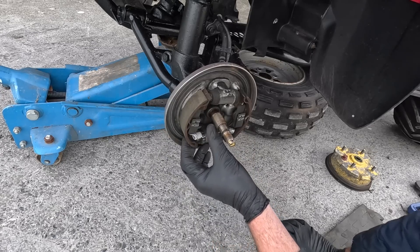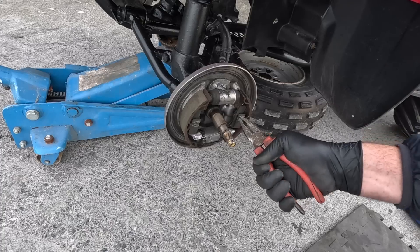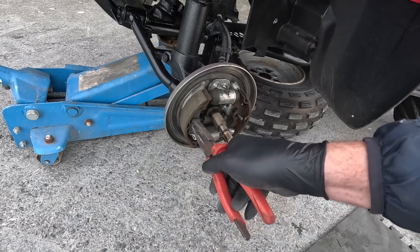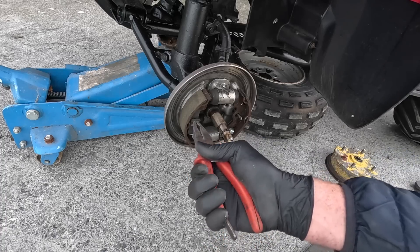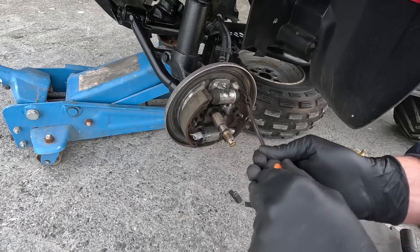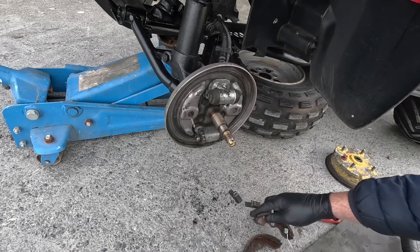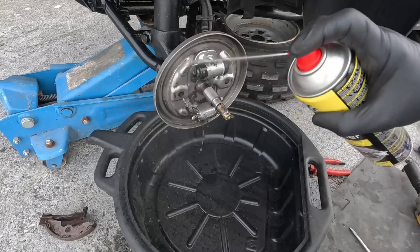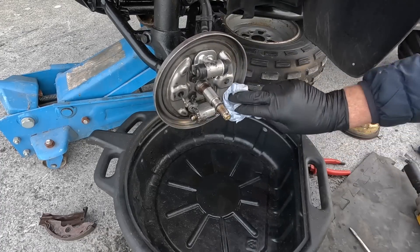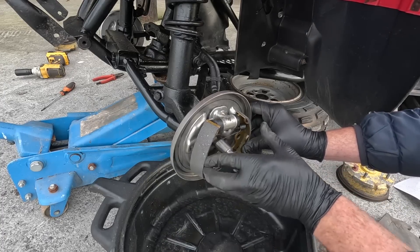They're probably hardened - it's just a long time since they were changed, but they're certainly not worn down. We're going to change them now anyway. You just turn this lad here around like that and that little clip will come out - same here. There's a wee spring we need to loosen. That should pop off. That's our brake pads off. We've got some brake cleaner - let's slide back in our pins.